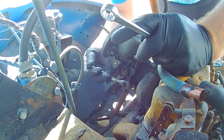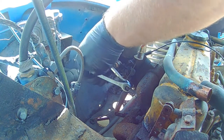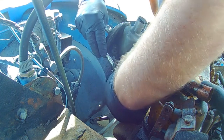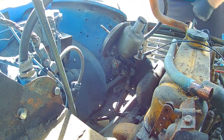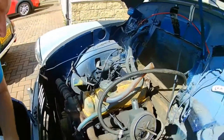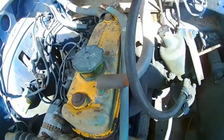Right, the same procedure for the throttle cable. I'm not worried about marking any of these because all the cables, like most of the parts in here, will be getting replaced. See the routing — it obviously comes through the bracket here, so I'm going to mark that up and do what I've done with the other one: stick it on the firewall using duct tape, keeps it out of the way. Next I'm going to take off the vacuum pipe here, which is just a pop-off — this connects to the distributor, so I'll tuck that away.